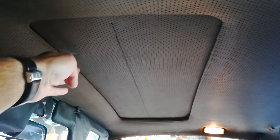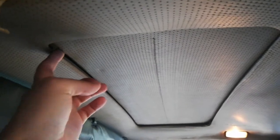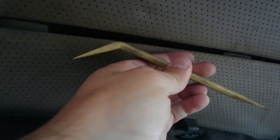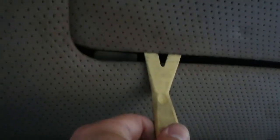My sunroof hangs up or slips on the driver's side. The first step in repairing your sunroof is, if it's still operational, retract it about four inches back. Since mine is not operational I'm just going to retract it as much as I can to expose this front edge, because I need to get in here and release some clips so the sunroof panel headliner piece can pop off the bottom of the sunroof panel.